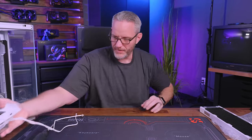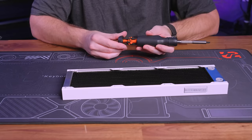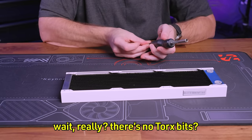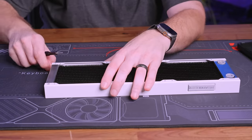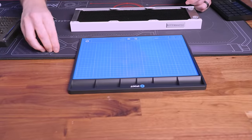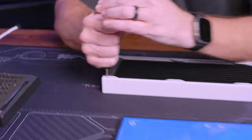I'm going to set this one aside for now because I'm not entirely sure I'm going to leave the fans or ports on that side. I want to take this apart to see what the construction underneath is like. Let's see if this screwdriver has what I need — otherwise I'm going to have to move on to my iFixit. iFixit to the rescue. There's no Torx bits on this screwdriver — fail. So for those wondering, it's a Torx T8 size for these fittings. This allows you to take it apart and custom paint it if you want — I might paint this to go along with the Mega Man theme.